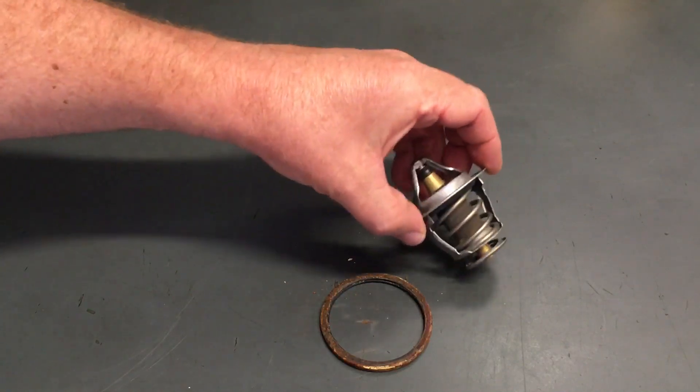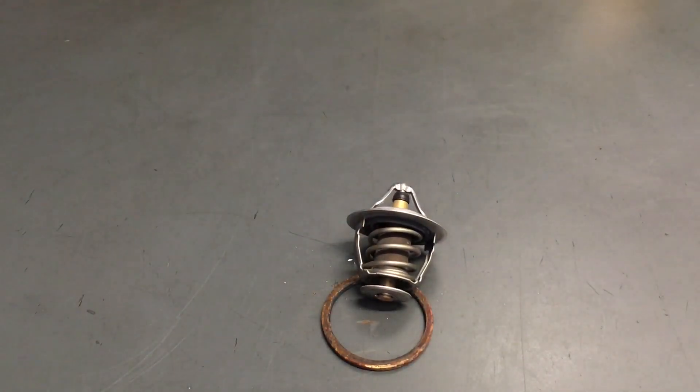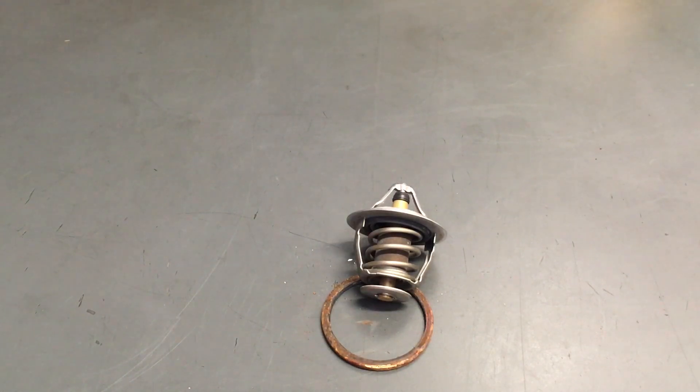The way to diagnose if it's working right: generally with these vehicles — I'm in Melbourne and I've seen a lot of these plugged in on the diagnostic — they all idle at about 83 degrees. It takes a while to get there but once they get there that's it. 82 is acceptable, 83, 84, maybe 85 or 86 thereabouts is acceptable.